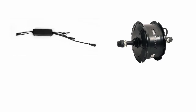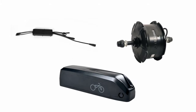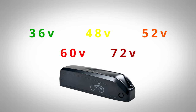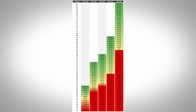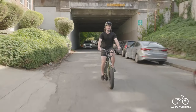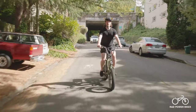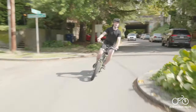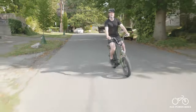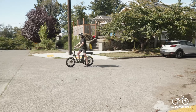The former two components have a larger role in the amount of power an e-bike can have, and the battery has a relatively smaller role. Your standard e-bike battery will come in three different voltages: 36, 48, and 52 volts. Higher-performance e-bikes such as the Sur-Ron or Onyx use 60 to 72-volt batteries, but those are more e-motorcycles than e-bikes. The higher-voltage battery you have means the more potential power that can be fed to the motor — so if you upgrade from a 48-volt to a 52-volt battery, you'll probably see a few more miles per hour. This is also why e-bikes can hit higher top speeds with a fresh fully charged battery versus a half-dead one.